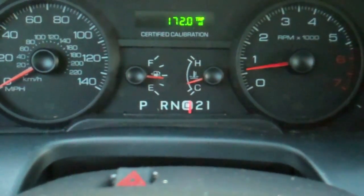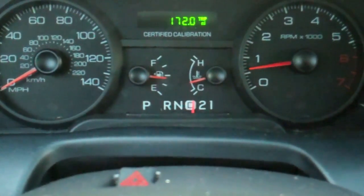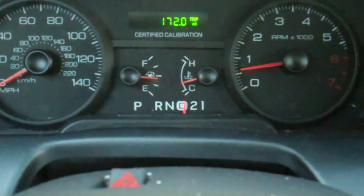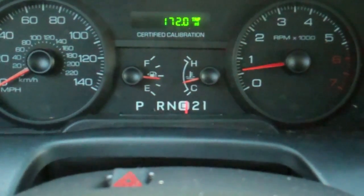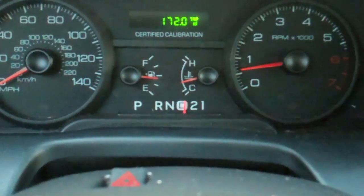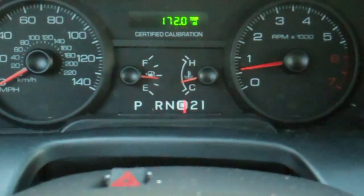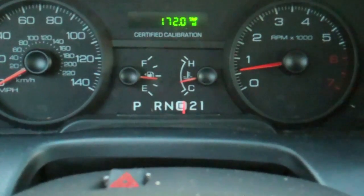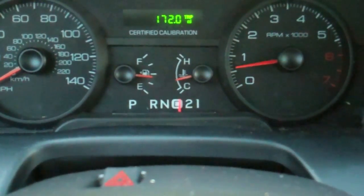When you're driving, most of the time you should be in Drive. This is your four-speed transmission — the car will shift between first, second, third, and fourth gear depending on the load: how much you're pressing the gas pedal and what the vehicle senses the needs are. This will also give you the best gas mileage because you'll be shifting into fourth gear, which is overdrive, and the car will be revving the least amount per mile driven.